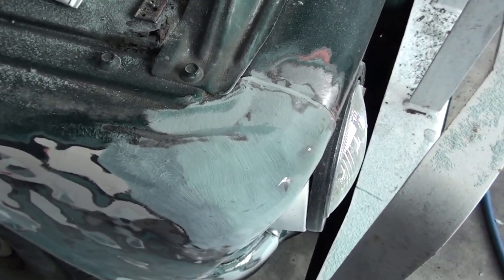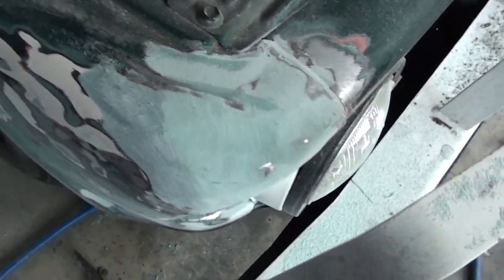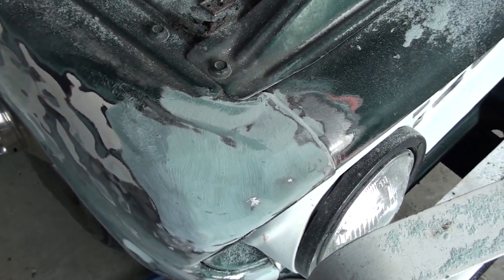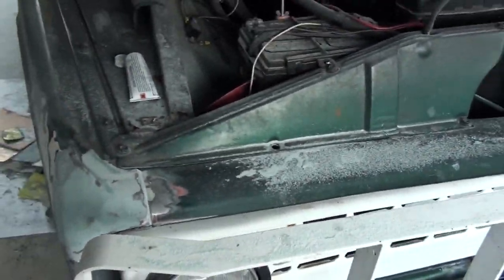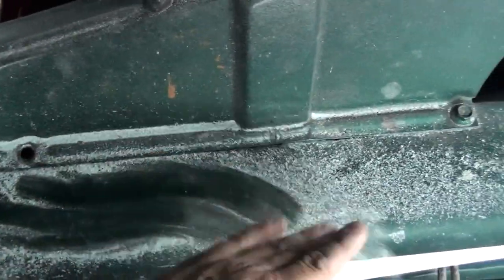That's actually been tore — I took a MIG and spotted it up, took short strand fiberglass, filled it, and then on top of that I've laid just some regular old body filler right there. That's 12-13 year old body filler — what the hey, right. As you can tell we've been making some dust; the motor's covered over.